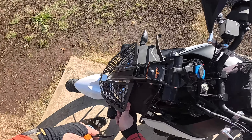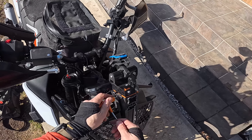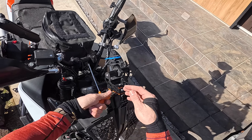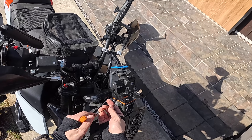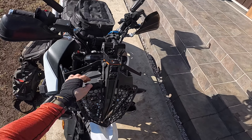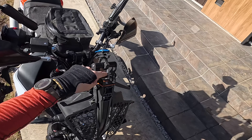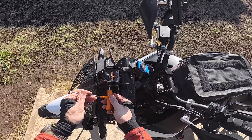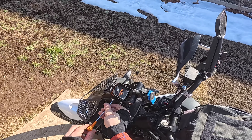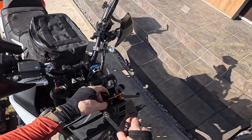So that comes off. Let's go ahead and remove the mounting frame for the windshield here. You can see I already have different bolts up here, because the KTM OEM bolts are just like cheese — these Allen bolts they give you, I swear they're made out of like iron or something. Just absolute garbage, they get stripped out really bad. This upper piece here is holding the headlight guard, the windshield mount upper mount, and also my GPS mount. So I wanted to make sure to have some nice stainless steel bolts up here to keep this whole assembly together.